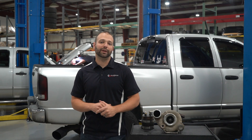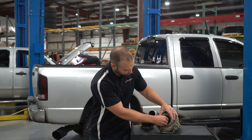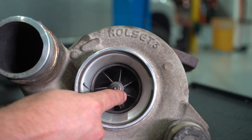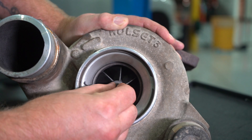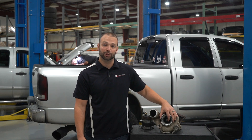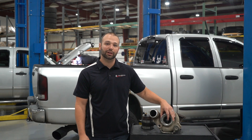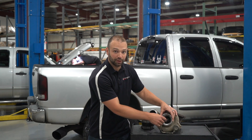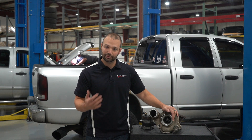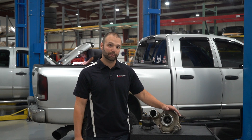Next, take the elbow off the factory turbocharger — that's the inlet, the piece that fits right on the front of the turbocharger right here. I want you to peer inside the turbocharger. Spin it — does it spin freely? That's good, it should. Feel it side to side; it should have a little bit of play without oil in it. Does it feel like it's scraped the inside of the compressor cover at all? Look inside the compressor cover — is there any visual damage of aluminum on aluminum? Look at the blades on the compressor wheel. Do they look dusted? Are they rounded, or do they not go all the way to the edge of the compressor cover? They should be sharp looking with a sharp edge right at the edge of the compressor cover. Rounded blades — no good. Buffed off the edge by the compressor cover is a loss in efficiency; you've lost a lot of power.